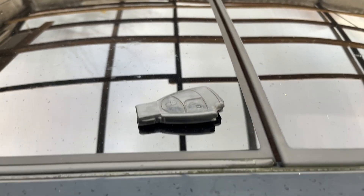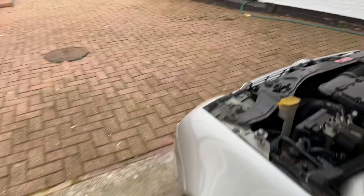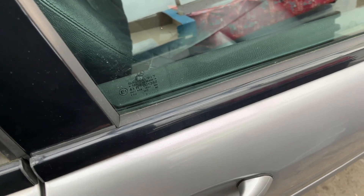I'm going to jump out and shut the door. With this particular car you've got to dismantle the key just to get the blade out, because you've got your lock and barrel on the driver's door — the boot is just a switch. On the passenger side door, older cars won't be like this. The passenger's door hasn't got a barrel, so the passenger's door is locked and the boot will be locked. So what we're going to do is just manually lock the driver's door. Remember: you've had your last chance with the central locking once you disconnect the battery. Get the blade in, check they're free, check you're doing it the right way — you can see the little mechanism inside. That's it. Locked.